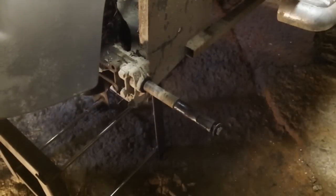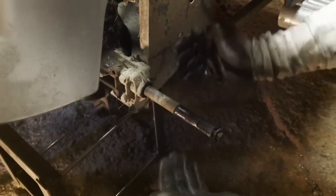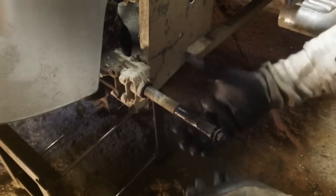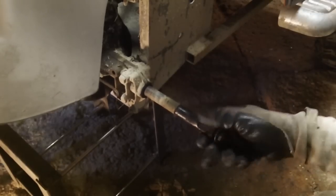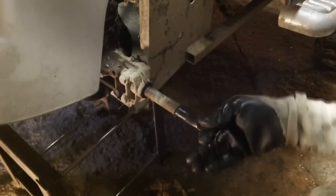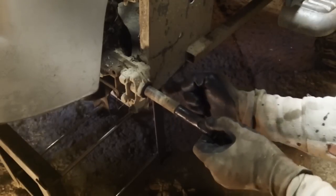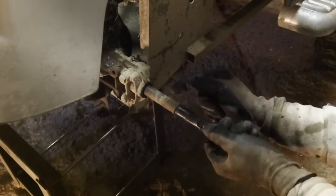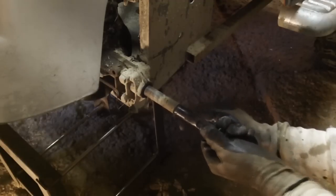Okay. Right there. Yeah, leave it right there. So we're just getting ready to tear the transaxle out, and what we ended up discovering was on this side here, I don't know if you can see that in the video, but it literally has play from one side of the case to the other in the entire axle. The other side isn't as bad as this, but that's a pretty good indication something has gone haywire.